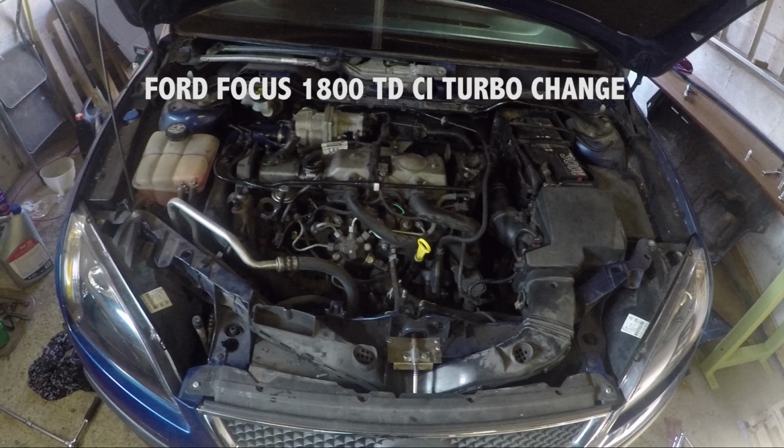Obviously the one on the turbo is like the exhaust clamp and didn't need any. And on the back I thought I might need one with the 2 bolts, where it fed onto the rest of the exhaust, but no, I cleaned it with a wire brush, bolted it up, no leaks whatsoever. So I got away with that. And also the cooling tube, I didn't put any new gaskets with that, and there's no water leaks whatsoever.